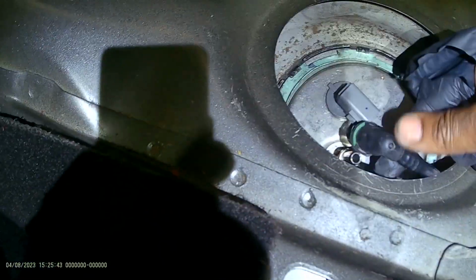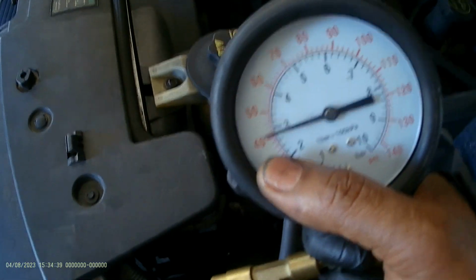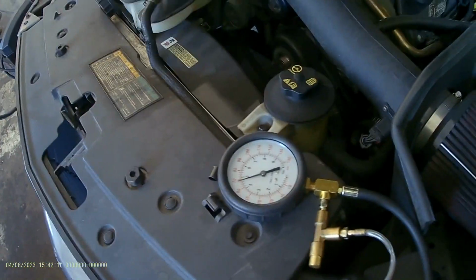So we got the fuel pump nicely installed. Now we're going to connect it. As you can see, guys, the first thing that I did, I cycled the ignition twice. So we already got 40 psi. Now with the car running, we got 70 psi. It's 30. All right, we already let it sit for more than 20 minutes, guys. The pressure stays solid. All right, I think job done. See you in the next video.